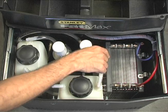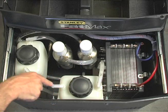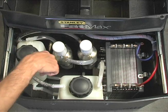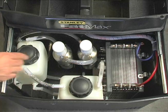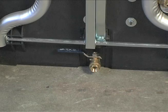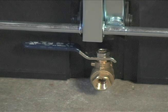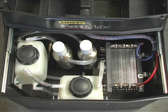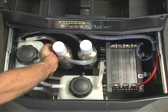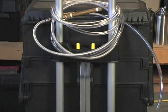Here's the setup: the HHO comes out — it's in the water, comes out of the cell into the first reservoir and dumps the water there. The HHO gas travels through this tube into the next reservoir. The water circulates between the two reservoirs from a bottom tube. The water from the second reservoir goes down into the cell. There's also a T right here — I've got it going to the back of the box where I installed a drain with a brass ball valve. It comes out of the secondary reservoir into the two bubblers, then loops around below, goes through a brass fitting, exits the back of the box, and out to my tube coiled around the back handle.